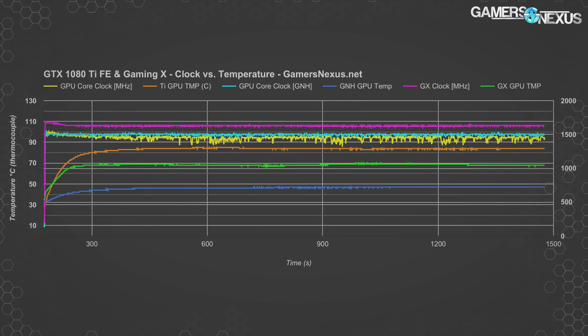Adding the Gaming X to the chart: it is pre-overclocked, hence the higher frequency, and it shows the flattest frequency line of all three. The Hybrid card removed the thermal constraints but immediately ran into power and voltage budget constraints. The Gaming X encounters those at some point too, but they're pushed back enough to further flatten the curve, with the pre-OC boosting frequency partly thanks to the massive VRM, while keeping GPU temps at around 68°C with 50% fan speeds. This is higher than the Hybrid mod and lower than the reference board — well below the thermal limiter — so we should expect a generally higher frame rate or better frame times on the Gaming X.